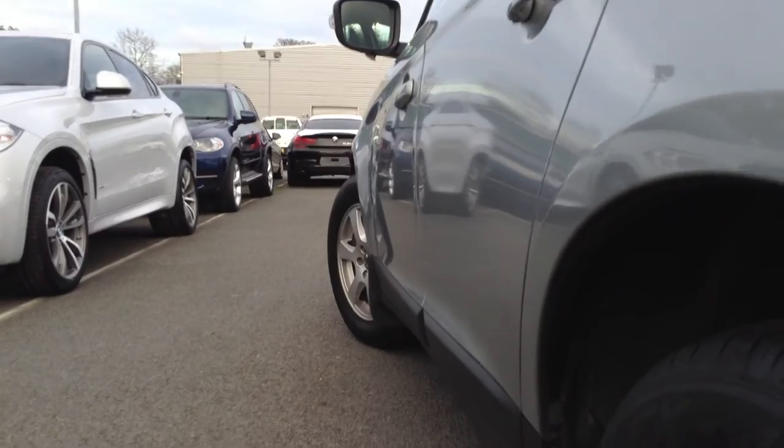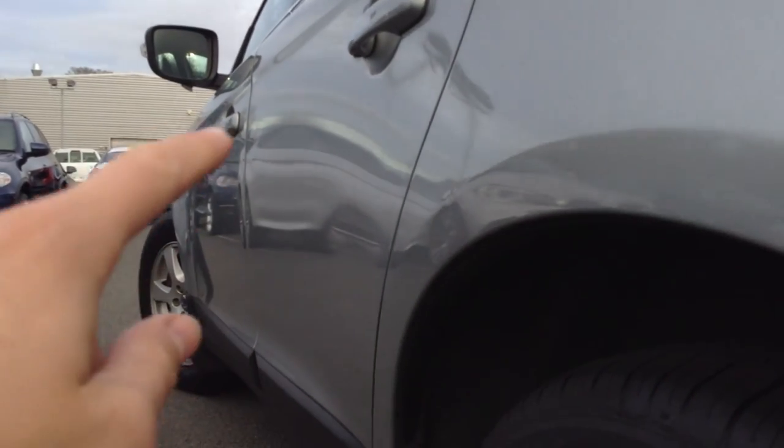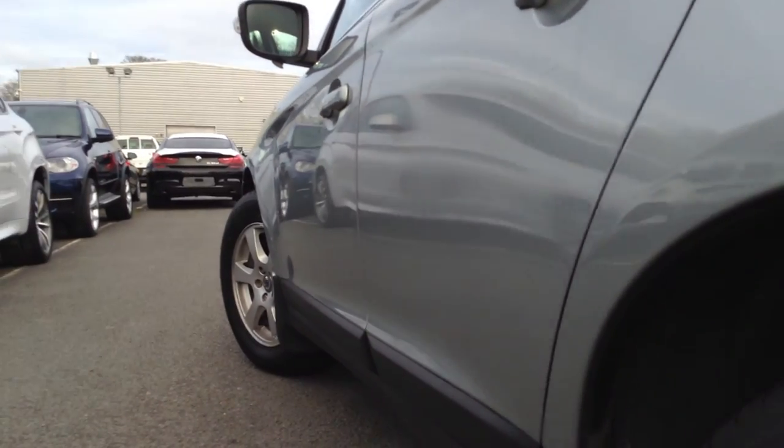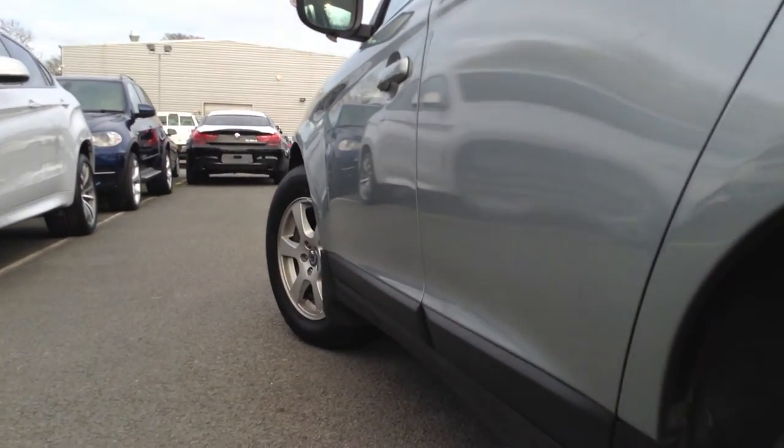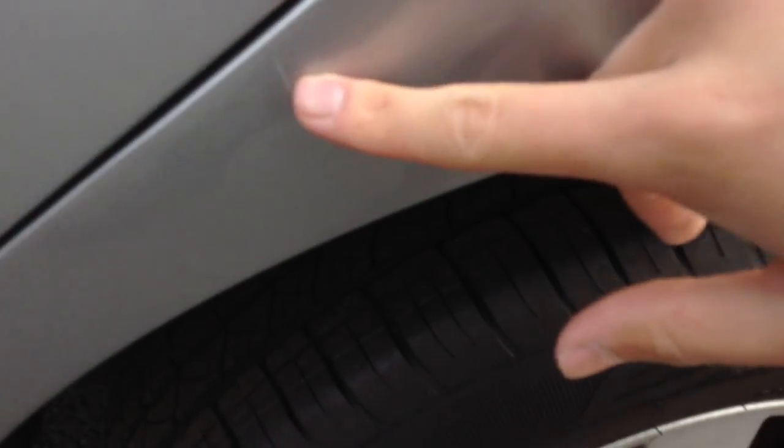Looking down the nearside of the car, it looks like the rear door has had some paint — you can definitely see filler in the rear door. Compare the reflection to the front door and it's clear it has had paint to the rear door, so just be wary of that. There's a scratch behind the door that should polish out, a couple of scratches on the door itself that should mop out, and some light scratches, some a little bit deeper, such as the one behind the front passenger door.